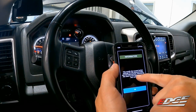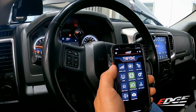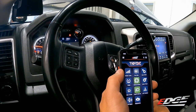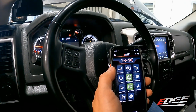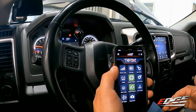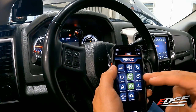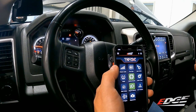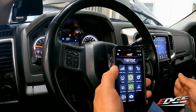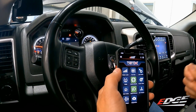Button recall is one of the best features of the Easy X, especially for towing. When activated, the app icon lights up green, and the system remembers your exhaust brake and tow haul mode settings. Normally when you shut the truck off it reverts to factory defaults — exhaust brake and tow haul turn off. With button recall enabled, when you restart the truck those settings are restored. So when you stop for fuel every 250 miles while towing, the exhaust brake and tow haul mode will automatically be back on when you leave.